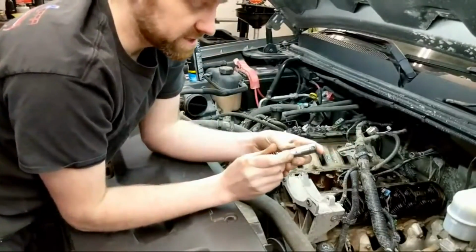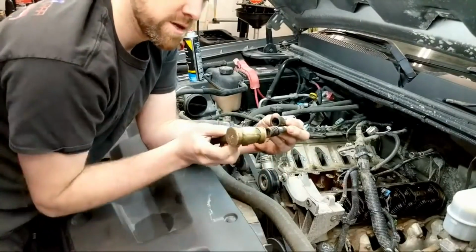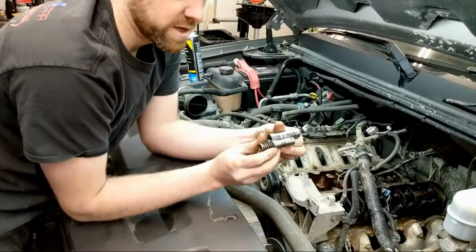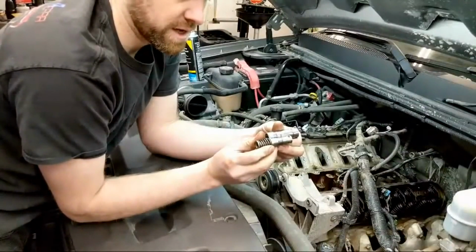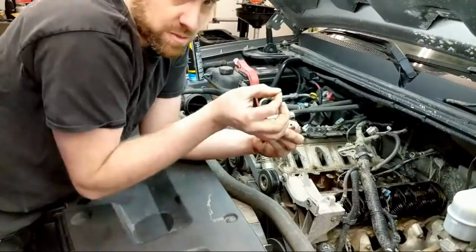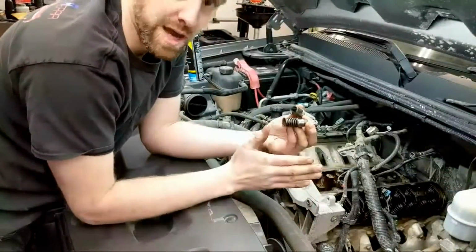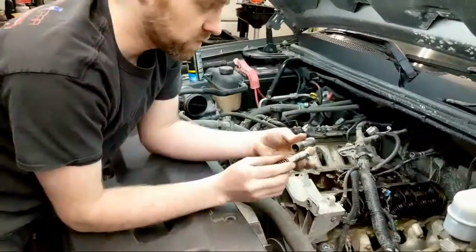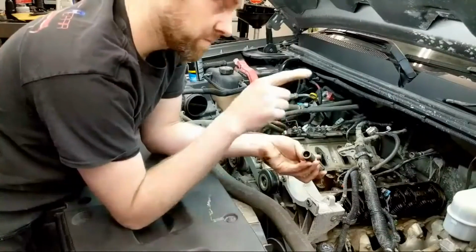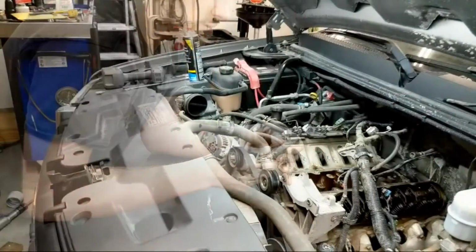So what I'm hoping is, if in that position, I'm going to slowly tap and let this thing go down, down, down until it comes to the bottom. And I'm hoping that I'm going to hear a little click. If I hear a click, then I know those paws have popped out. If I don't hear a click, and all of a sudden it just stops going down, I'm going to assume it's in the same situation. So that's what I'm going to try, and then I'm going to throw the rocker arm back on, turn the motor over, and see if the rocker properly activates.